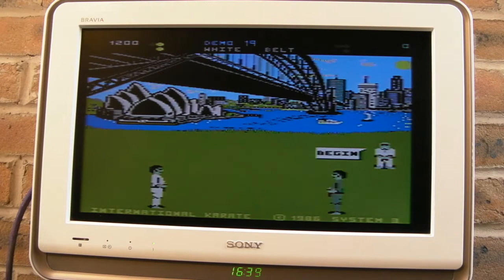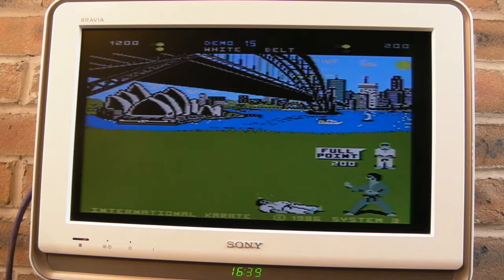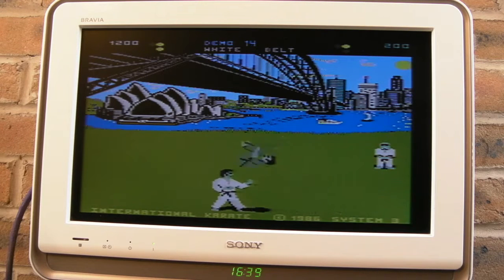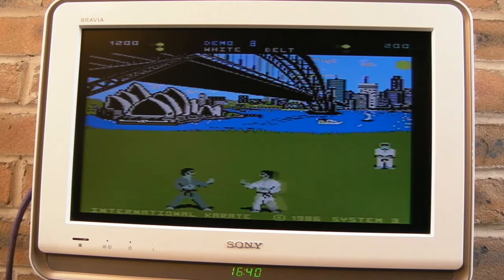Why? Because the colour part is calibrated, or was calibrated, to take into account the deficiency in that diode. So you can see this is green, not yellow. And it's stationary, it's stable, it's rock solid, it's not jittering around, it's not changing. So we now need to adjust that colour part, so I'm just going to do that.